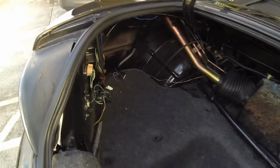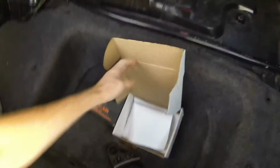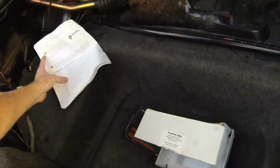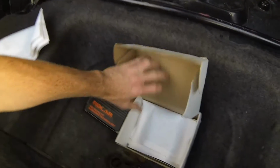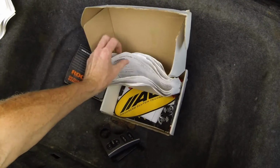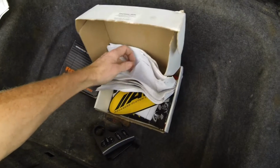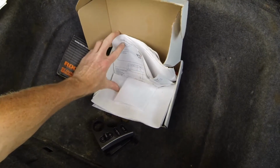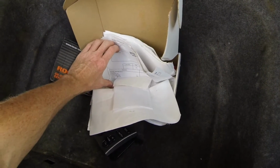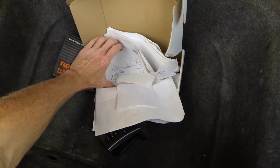As you can see, where this little interior cloth is missing, there's this one on this side, and this one over here is missing. And these are papers, receipts of things that I purchased, and a non-Carfax thing. What is this called? It's a little accident report thing. It just goes through vehicle checks and whatnot. Goodyear, from when I had the alignment done, a little over a year ago now. And then receipts from the previous owner, this is the one that's got the service, the machine head redeck pressure test, clean and hot tank, 5-angle valve job.